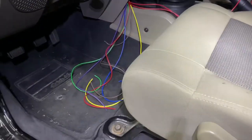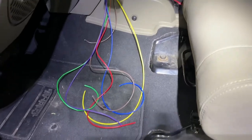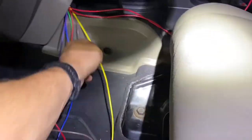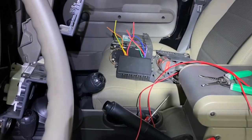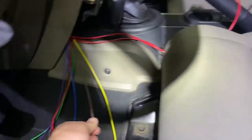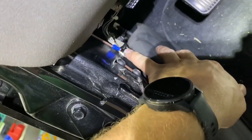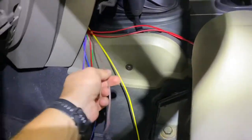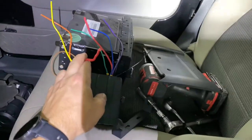Quick update — things are going pretty well. There's a ton of wire here laying on the floor but believe it or not there's a method to the madness. This is the ground wire — remember I told you you've got to have a ground wire going straight to the switches. I've got that hooked in right here with the factory ground. The short brown wire goes to ground and then there are two really long red wires that go to the main power on the switch.